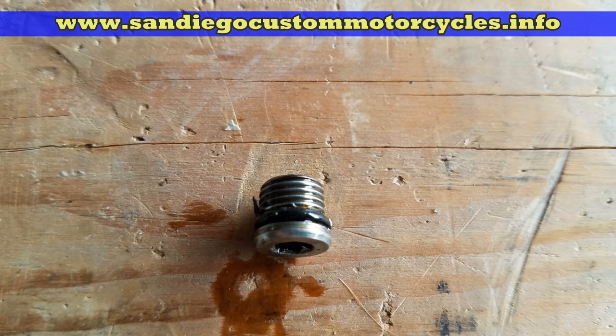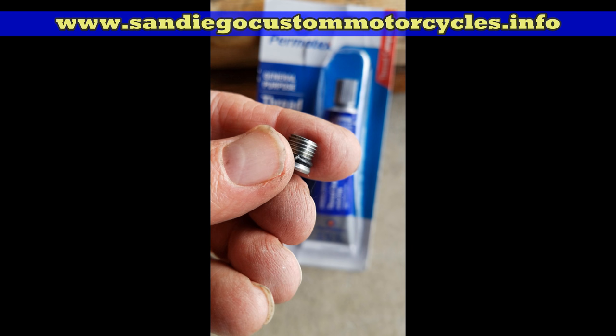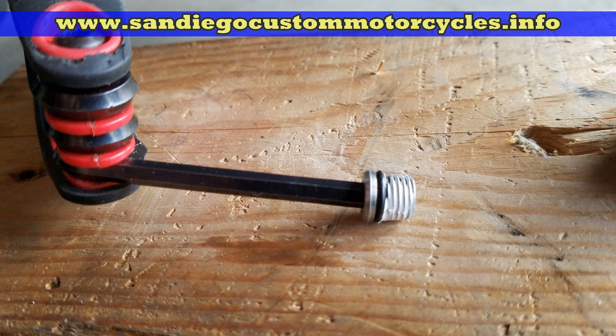Also look at the o-ring on there. If it's in good shape you may not have to do anything. Here's one you can see is pretty eaten up, so you want to change that out — put a new o-ring on there. Just like on the oil filter, put a coating of oil around the o-ring so it seals good. I always use a liquid Teflon paste around the threads; a lot of people don't do that, but I've never had a leak, so why not.